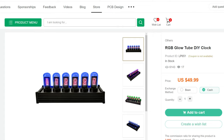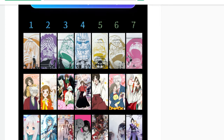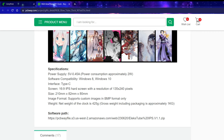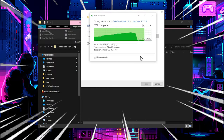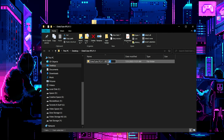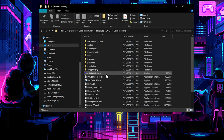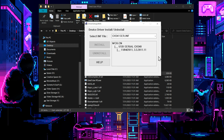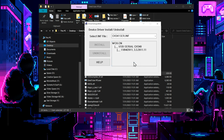So if we look right here on the product page and scroll down, right at the bottom here it shows all the different styles and stuff that are available. And you can even change backgrounds and then add the keys or the numbers over the top, which is really cool. It gives you the software path, so you can just go ahead and download it here. We will unzip that right now. One thing that I did realize when I was working with this the first time is that you actually have to get rid of the Chinese characters at the end of the folder name. If you don't, it has some problems with the way the driver installation goes. So you'll just go to install the driver, click yes, and that will go no problem. Just click install. If you hadn't renamed the folder, it fails right now because Windows gets mad about it. Drivers install successful — we can close that.